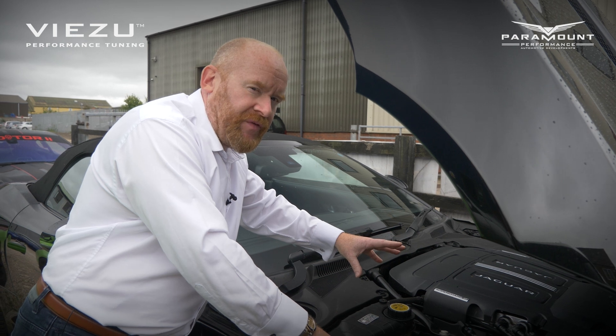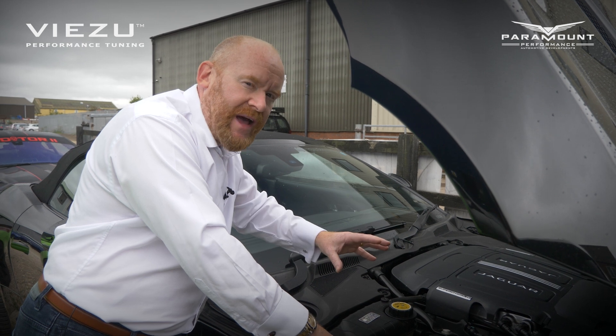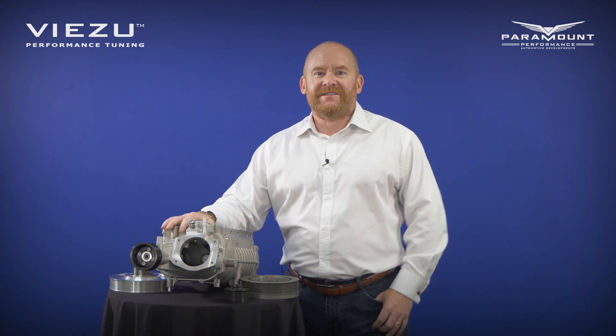As the engine just shut off there, you heard that slight carry-on — that donk-donk-donk-donk. The engine is cold so it isn't particularly loud on this one at the moment, but it will get worse as things warm up. That is the sound of a failing coupler bearing.